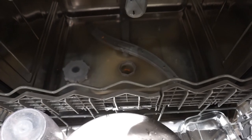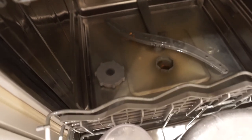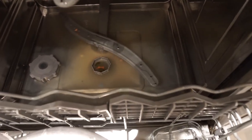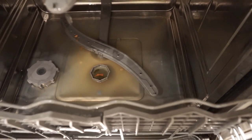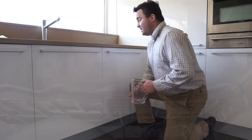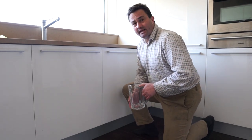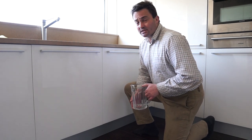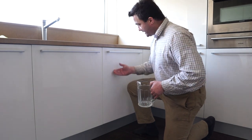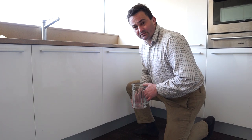Pouring the water won't cause any damage, but you should see that the bottom of the machine is covered in water during its wash cycle. If you're not seeing that bottom area full of water, it's quite probable you may have an issue with the transfer hose. If adding the two jugs of water during the cycle caused it to heat up and wash correctly, most likely that is a problem with the transfer hose. Now I'm going to go through the process of getting the dishwasher out and locating and cleaning up that transfer hose area.